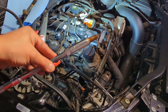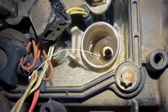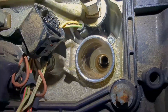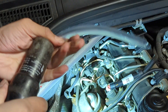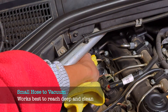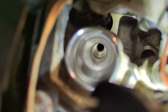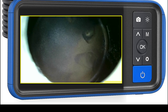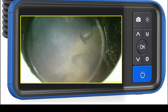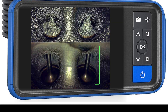Pull the spark plug straight out. On the tip, it's actually still very good — it looks great. After pulling the spark plug out, you can see there's rust inside, and I definitely don't want that rust to go back into the cylinder, so I'll use a vacuum to clean it. I inspected one of the cylinders using an endoscope through the spark plug well. The piston appears remarkably clean, with minimal carbon buildup across most surfaces, except for a small area perhaps near the intake valves. I plan to clean the intake valves at around 100,000 miles on this direct injection engine, as it's prone to carbon buildup from oil and blow-by gases.